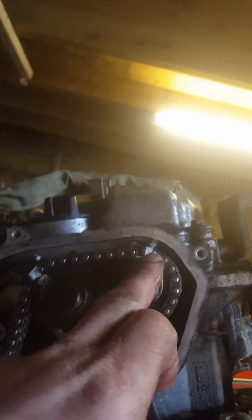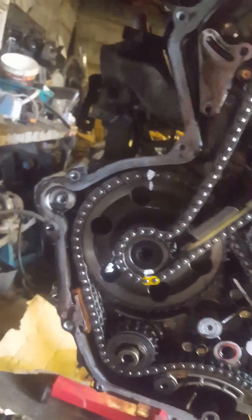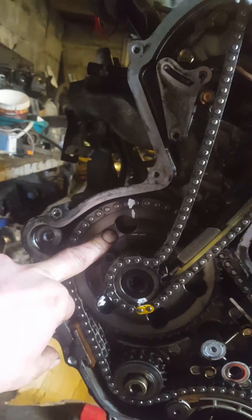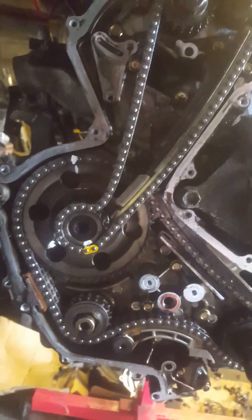The other thing you can check, off the keyway - that should come straight up, line between the two top cogs, which creates a direct line to let you know it's spot on. It doesn't really matter where this sits; it's just so you can time it off the top pulley without taking all the bottom cover casings off, if you need to change just the top chain or do the head. So there we are, job done.